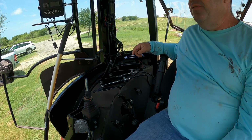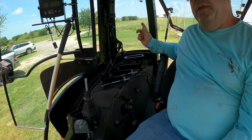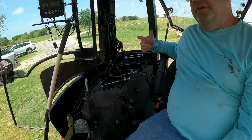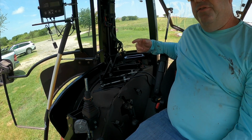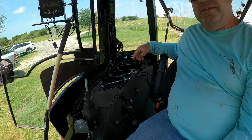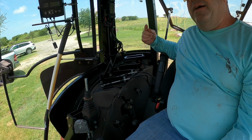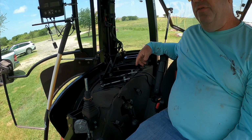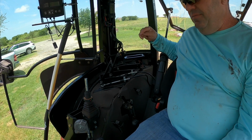This right here is actually decent for its size, but it's an open center hydraulic system. And if y'all are interested, if somebody comments on it, I'll let you know what the difference is. I got a YouTube video I can link you to that gives you an awesome explanation. It doesn't say pros or cons about them, I think it just walks you through them. And as soon as you start thinking about an agriculture sense, about what you need, what you're trying to do, you realize a closed center hydraulic system is so much better than the open center.